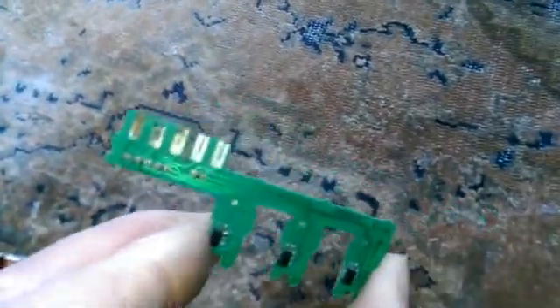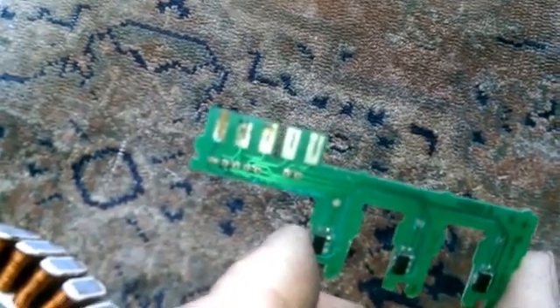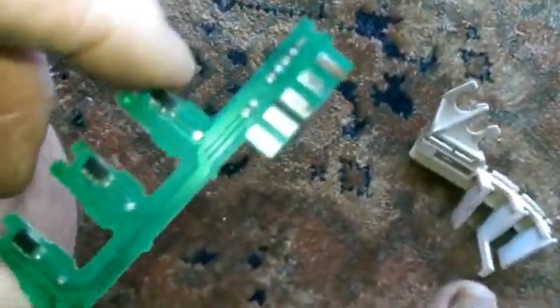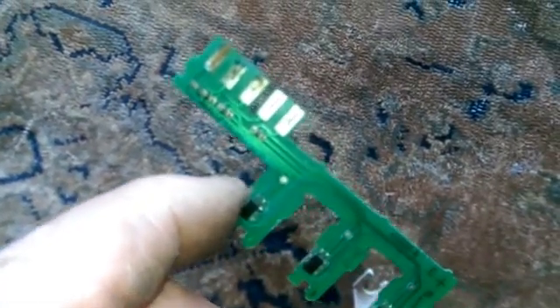And slide the card out of the holder. You'll note the very corroded contacts there — all five of them. If they are very badly corroded, you will have to buy a new rotor position sensor and put them all back together. Good luck!